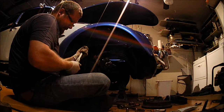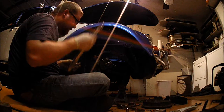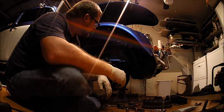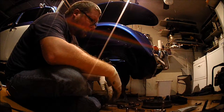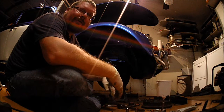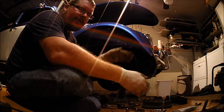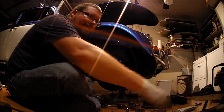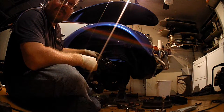So that bracket is on there. Not the most expensive torque wrench but it works. Next we have to press in our races and pack our wheel bearings. You don't need a $5,000 press — just put the bearings in your freezer and they'll shrink up so they slide in nice and easy. If you have a press, press them in. So far we've learned one thing: there is a left and a right side because of the arm coming out for the tie rod — it would hit if you used the wrong side.